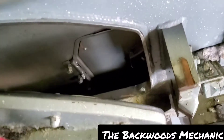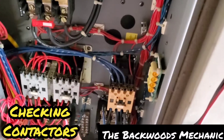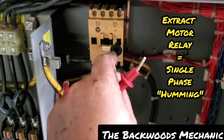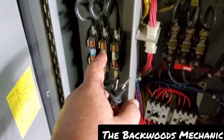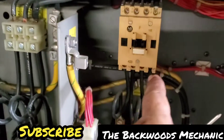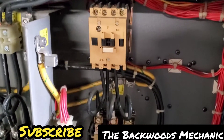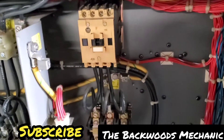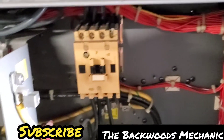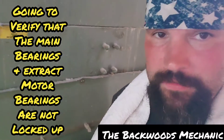Now we're going to check the contactors here. That's the wash motor, that's the dump motor, and this one should be the back motor we're having problems with. I've checked all the fuses coming into it — fuses are good, proper voltage. It comes down to this second set of fuses, loops around, and goes over to this contactor. When we push it in you hear a large humming sound — that's supposed to engage that motor. That motor should be sending a signal through that centrifugal switch we checked earlier. It sounds like it's single-phasing when you push it — it ain't doing nothing but humming.